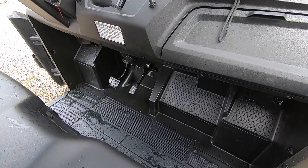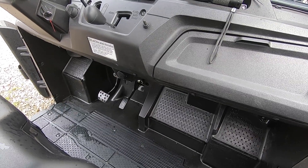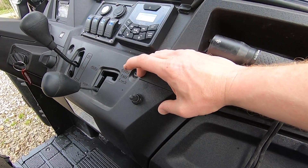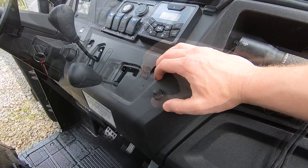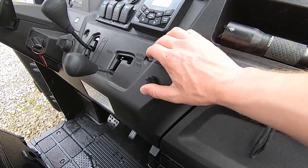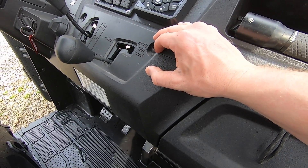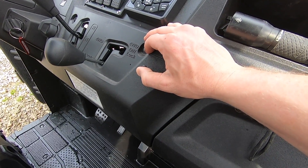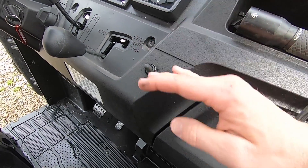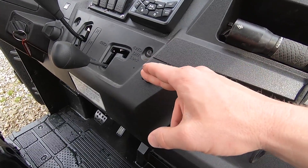It's a very simple circuit: you have fused switch power coming from the battery running to this switch. I'll leave a link below in the description for the switch and the actuator that I used. Basically this is a polarity-reversing switch. When you hold it one direction it sends positive and negative 12 volts on the two wires to the actuator, and when you hold it the other direction it reverses the polarity — that's how actuators bring things up and down. It's also a way you could reverse a motor.